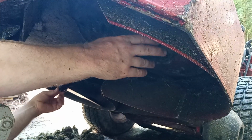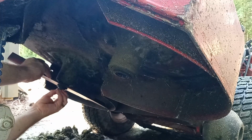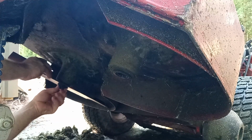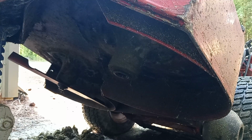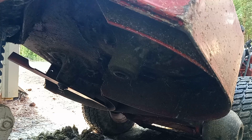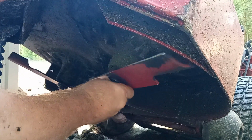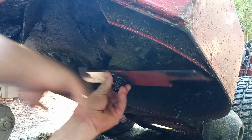And the only thing I do not like about these spindles, guys, is you cannot lube them. I was brought up with the company that you lubed everything. You can't lube these. And when you do a blade, guys, and you put it on, if it has fins, make sure they go in the air, flat side down. And this has to go exactly 90 degrees difference.